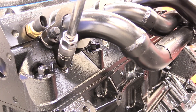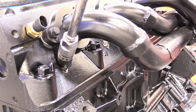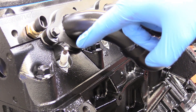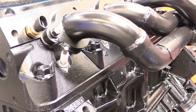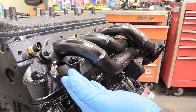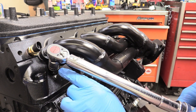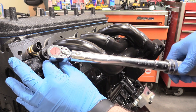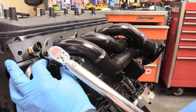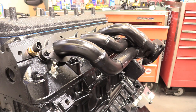I have the engine tilted up at an angle so you guys can see it a lot easier. Make sure it's on there snug. Be very gentle when you're removing your spark plug socket because you don't want to crack the porcelain. The torque spec is 11 foot-pounds for a used aluminum head like this one, 15 for a new aluminum head, and 22 for an iron head. Keep that in mind. We've got our torque wrench set to 11 foot-pounds. When you're putting your spark plug socket on, make sure it's completely on the spark plug nut when you're tightening because you don't want to round that off. Gently remove it, and then just do that seven more times.